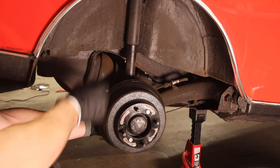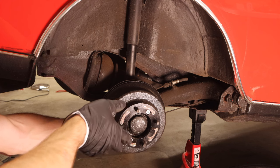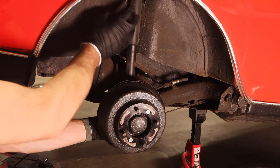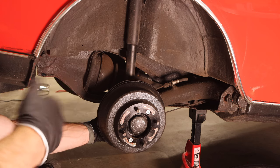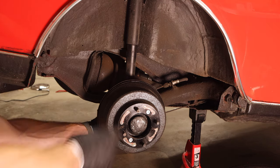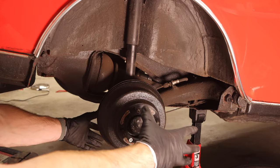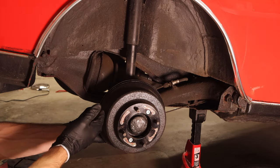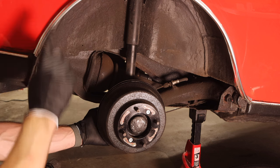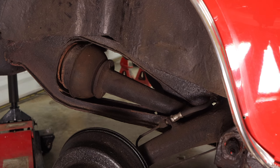On a Mini Pickup, it's actually quite easy — there is a nut on the top side of the shock absorber that's visible and accessible in the truck bed on both sides. In a saloon, you'll have access on the right side, but you'll need to remove the fuel tank on the left side to get to that shock absorber. We need to get to that top nut so this can sag all the way down. There won't need to be any other removals aside from that bolt, and we might need to take the bolt out of the bottom as well to move it out of the way. I'm going to loosen that up and then we'll be able to get to the cone.